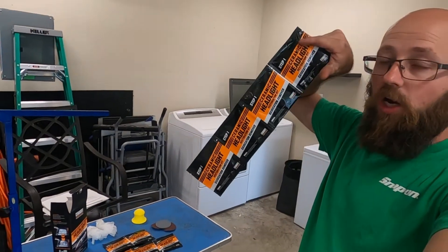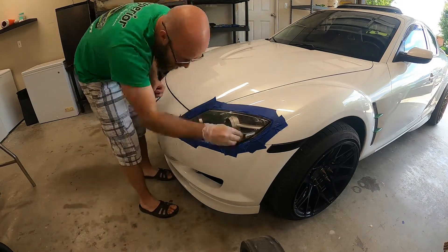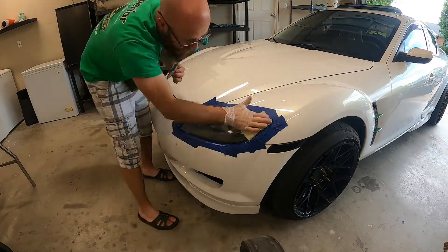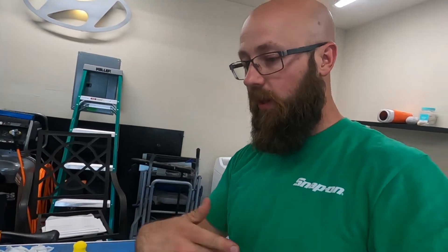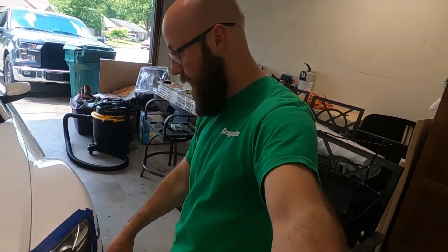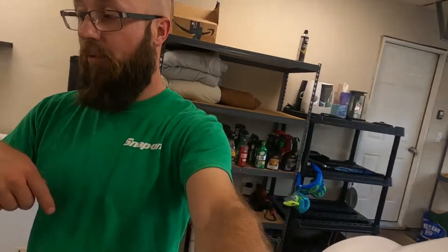So I got that taped off. The first step is taking this oxidization remover and wiping this down. The kit does come with some gloves — you don't want to be getting this oxidization remover all over your hands. I only used two wipes; after that second wipe the wipe wasn't getting very dirty, so I went ahead and stopped. Now once you do this step you do want to rinse the headlight, clean it off, and prep for the next step.